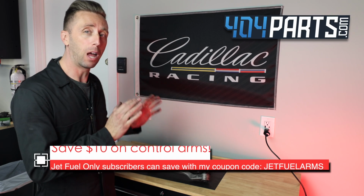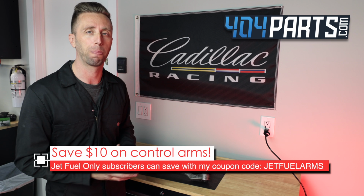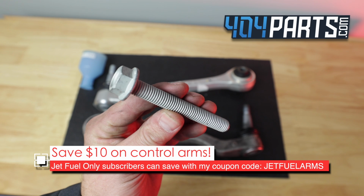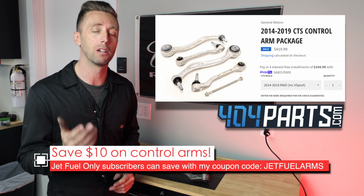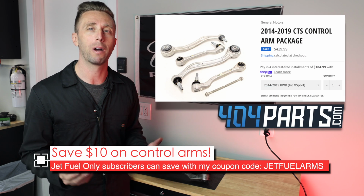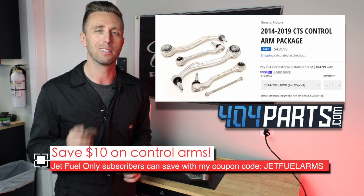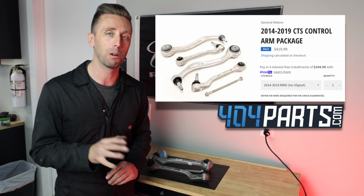So where do you get these parts? Well, you can get them from your favorite parts dealer. I work with 404parts.com. They have a whole kit of all 4 control arms, plus the necessary bolts that you have to replace. It's about $420 plus shipping, but you can also request to just get the arms you need, but I always recommend getting both sides. Don't just replace one side, it's not the right way to do things.